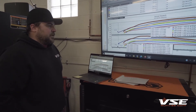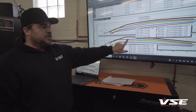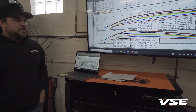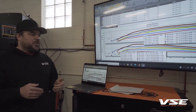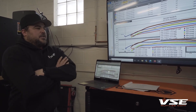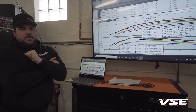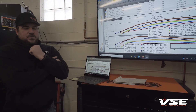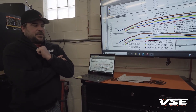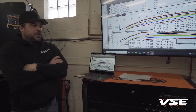As far as power levels go, the max EGTs we see on the 595 horsepower version is about 1,420 degrees Fahrenheit, again over two and a half minutes of pull. We do keep back-downs in place, so if you're full throttle and there's a runaway EGT condition or the truck's heat-soaked, it will continue to pull fuel out. We feel these are pretty good for 2017 to 2021. We have five L5Ps and have tested these over 12,000 miles combined — the 2020 and 2021 for towing and drag racing, and the 2017 and 2019 with about 6,000 miles of testing and towing, verifying the emission system responds properly.